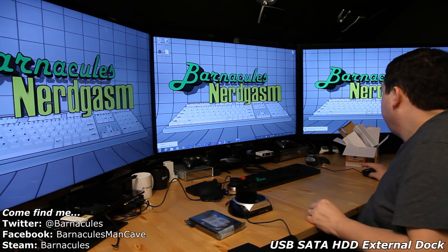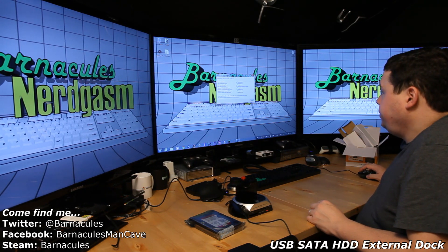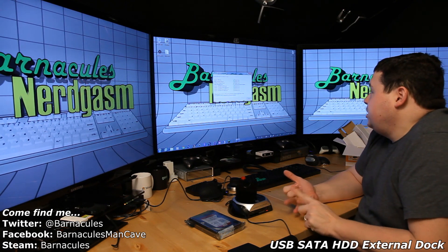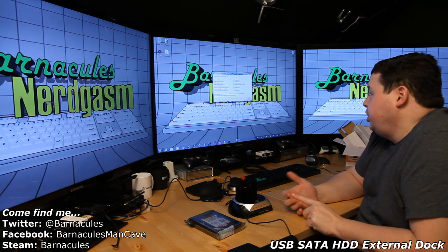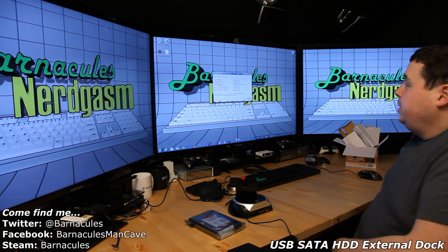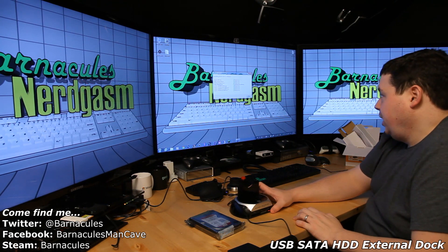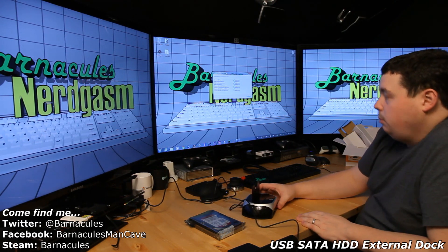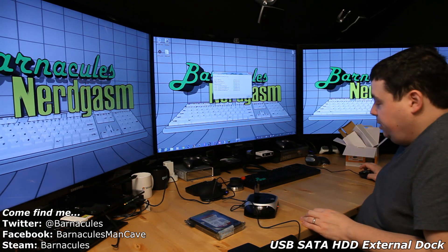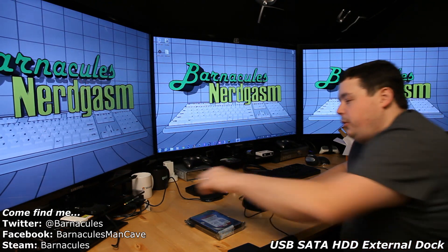It's USB 2.0 but I'm going to go ahead and plug it into my USB 3.0 hub. It says here we're installing drivers — shows up as a generic USB hub, a composite device, mass storage controller, and generic devices for all the different memory cards. Right now it's searching Windows Update for the mass storage device driver. It found it and it's installing. I'm running Windows 7 64-bit Ultimate on this machine and it looks like it's 100% inbox supported.